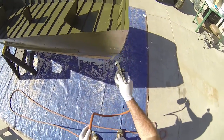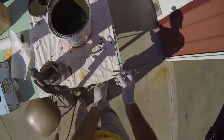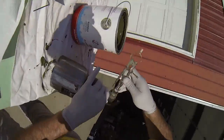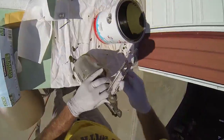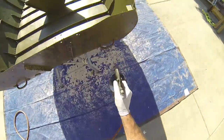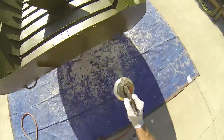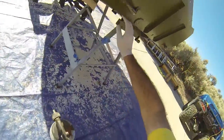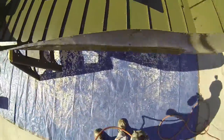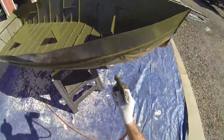And then on the outside, you have to stop and keep clearing the stuff that plugs up the head. It will start to stick. But the trick on the outside was that the masking tape would try to let go once it got warm, and you had to make sure it stayed sealed. You didn't want to blow paint up underneath the masking tape. And then little bugs would get in there, so I made one last pass all the way around and did one final overspray, and then we were done.